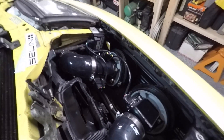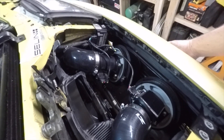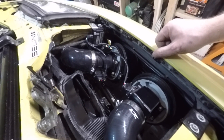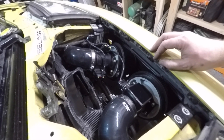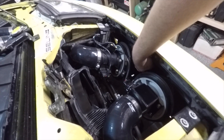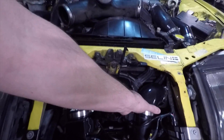After doing a little reading, I had tucked this rain shield up out of the way thinking it might be nice to get fresh air coming in. But actually, all that's going to do is let rain just blast the air filters. So I put it back down where it's supposed to be and then drilled two holes. The studs on the air filter actually protrude through, and I've got a little M4 nut on each one down there — it's pretty sturdy.